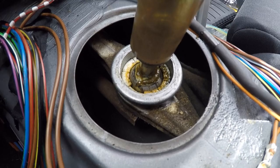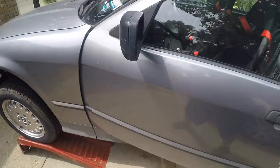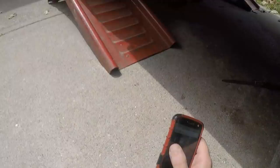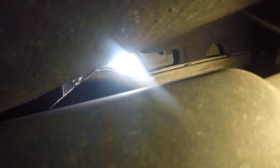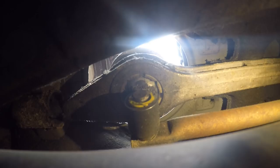I'm going to get under the car, jack up, remove that clip, and then move the rod out. Now that it's all jacked up, we're going to get under the car with a flathead screwdriver to get that clip out. There's our little clip right there — that's what we got to pry out with a flathead. You do not want to lose this clip, as it goes back on after you remove the shifter. There is the pin — I'm going to slide that through and push it out.